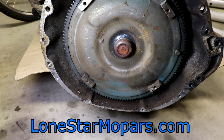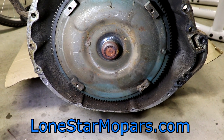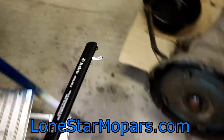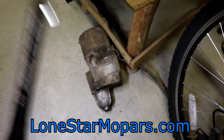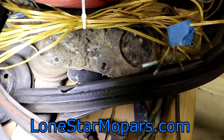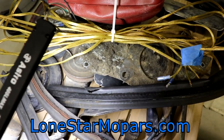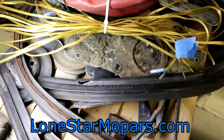There's a chance we might have to do some stuff with the dipstick and linkages to get access to the bolts. Right here is a giant starter — that's the old gear reduction, the signature Chrysler sound. A mini starter is going to be fractions of that size. And right here, that cruddy-looking thing is an inspection cover that came off that transmission — that's what we'll be removing from the truck.